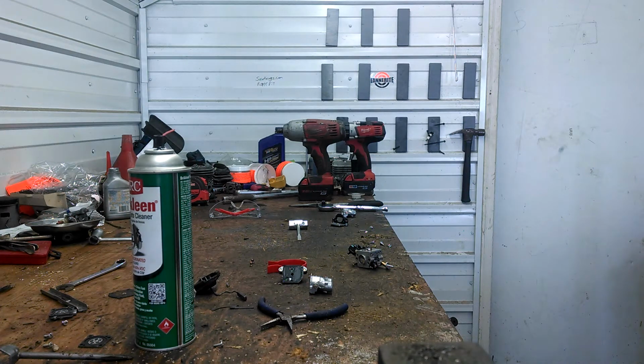Now the EL46 seems to be a little bit more temperamental. Not many saws have a problem. Most of it's a hesitation issue. There were very few 44s that had a hesitation issue, but you could take care of that by modifying the butterfly a little bit.